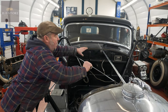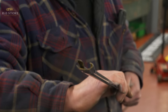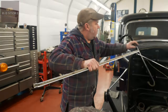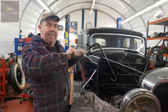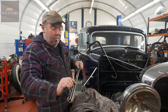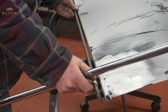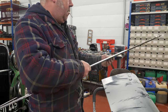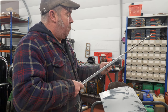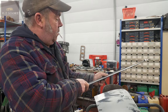The center bar just ships in there — that's how you hang your bonnet on that as your hinge. That goes into there and then you have one at the front. The front of that isn't very well, so I've got to repair all of that. Once you get them right, the bonnets when they're hinging up and down properly they're fine, but you have to clean out all your grooves, make sure everything slides in and out properly. It's pop-riveted to the side of the bonnet, that bit slides in there, and that's your hinge. You need to slide it on, clean it all up, make sure it all moves nice and freely — you don't want any grit in there.